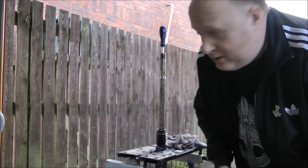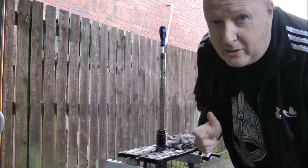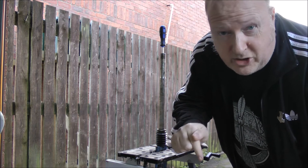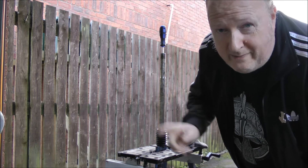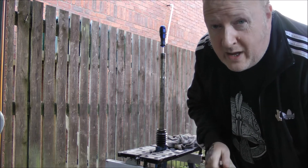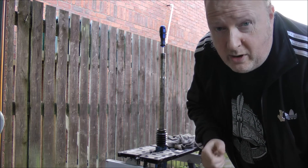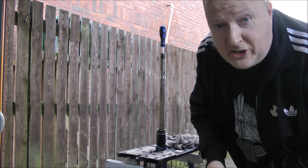I mentioned earlier I didn't think there was a screw in here, but there is. I've got a much more powerful but smaller light that I can fit close to my eye and peer down the hole — there is a posi-drive screw right the way down there. Thankfully I had the foresight to put quite a lot of penetrating fluid down there, so much so that it's actually loose. I do suspect someone's been inside this fork before. I'll just unscrew it and see what happens next.